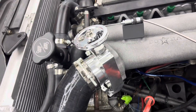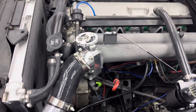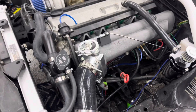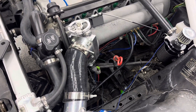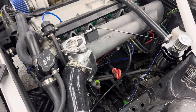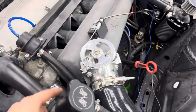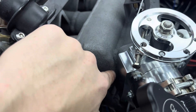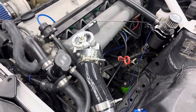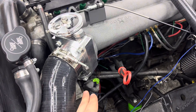The benefit to the Amazon throttle body is that the S90 throttle bodies are for Mitsubishi Evo 3s and have a piece on the end for an idle control valve, which I'm not running. I had to make my own adapter plate to cover up those holes since they lead right into the throttle body. The problem was the adapter plate could only be on one side, because the other side presses too far up against the manifold itself, and I didn't want to cut and grind away the powder-coated finish. That kind of locked me into having the throttle cable on the bottom based on how my throttle body was set up.